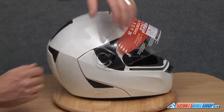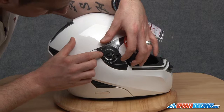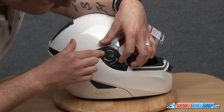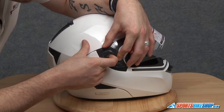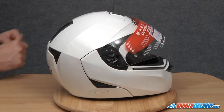Do the same on this side — again just locate that long arm first, then line everything else up approximately. Pop the rear lug in first, line the front up, pull the lever back, locate the front lug, and just make sure that lever resets right to the front.